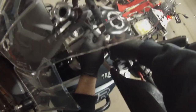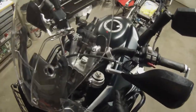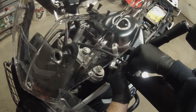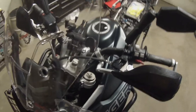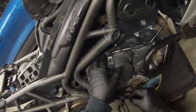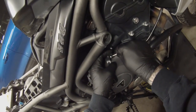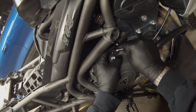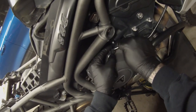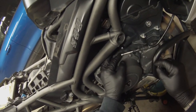If you're replacing your clutch cable, they don't come with a new collar and adjuster. I'm never a fan of people that use pliers on these because it damages it. Now that you've got that cable totally slacked off, just lightly push on this arm, grab a hold of the cable while holding this upper pivot point, and then you kind of pivot it towards you a little bit and that's disconnected. Push the arm a little bit towards the front, keep your fingers on this pivot point, push the cable, and now that is out.